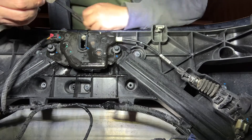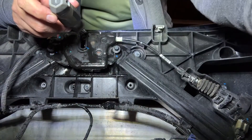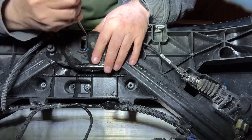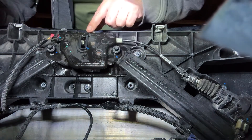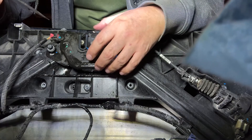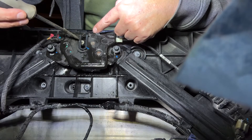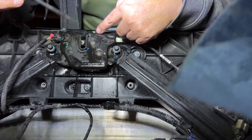When you put the frunk back down, it actually pulls down. The frunk is closed by the rod which pulls down into this channel, and there are two positions — the partially closed position where it goes click, and then the rest of the way down closing all the way. The problem I was having was it would go to the first click but not the second click, because this mechanism was a little bit frozen. I live in Canada and the weather here causes that. So I'm going to show you how to fix this.